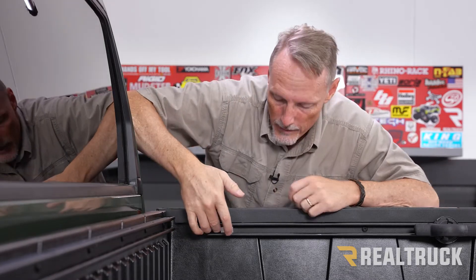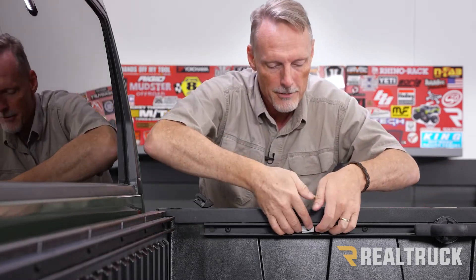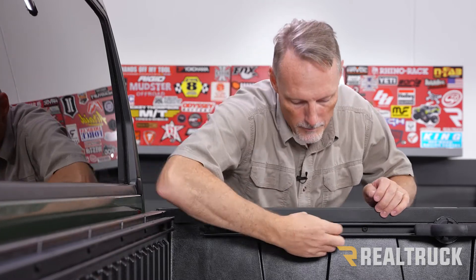This front block — don't leave it right at the plug location. Bring it back about a foot and a half or so because your canister is going to fit right in here. Then go ahead and replace the plug. Do the exact same thing on the opposite side of the deck rail.